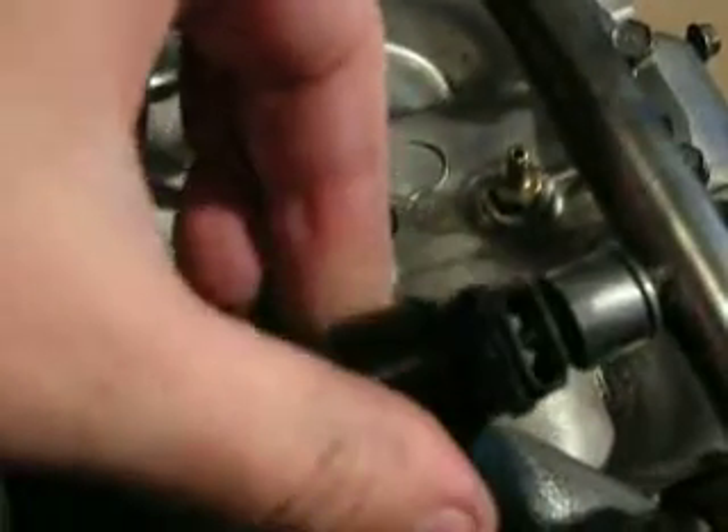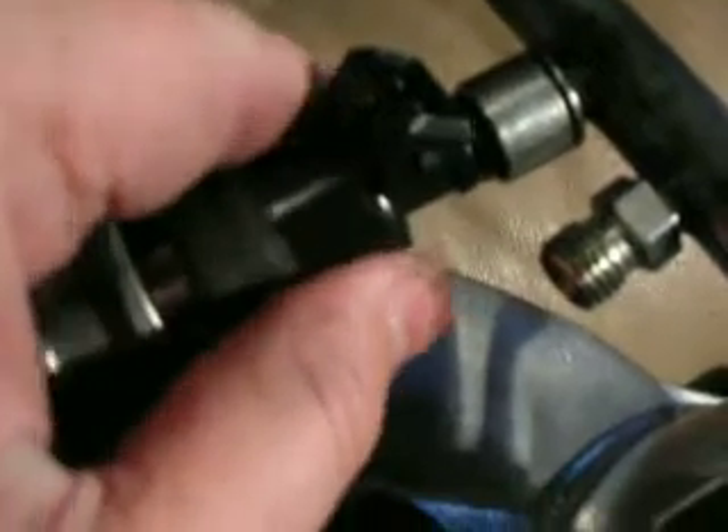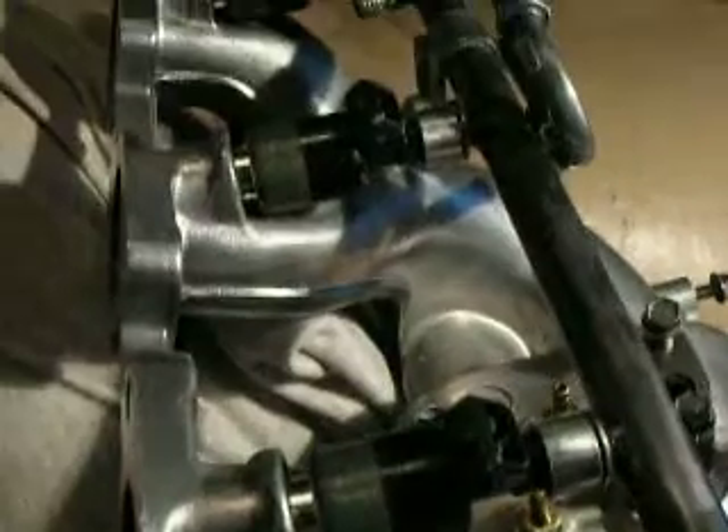Here's the main thing: you want them tight, but you want to be able to move them without them hitting the plastic on the top and bottom. You should be able to move them up and down about a millimeter. As you can see, I can move them up and down just about a mil. That way they're seated right, but not jammed in with pressure against the rail and the plastic on the injectors. You won't need the clips then. Good luck — thought I'd show you how I did it.